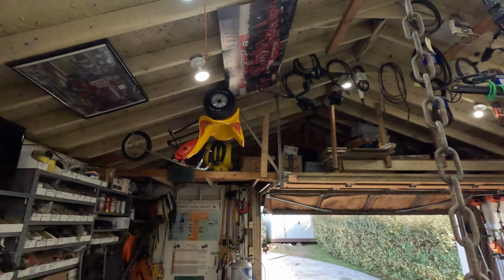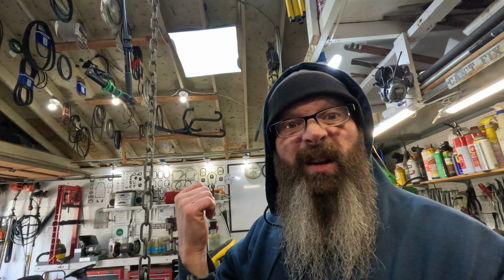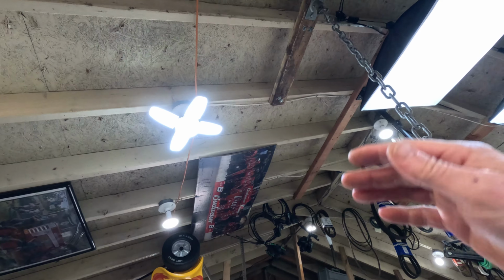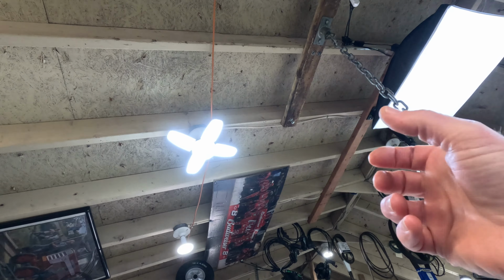So what I'm going to do, I just haven't done it yet. I've been meaning to for years now. I'm going to go to Lowe's or Home Depot, and I'm going to get something lightweight, like a 10-foot, 2 3/8 galvanized chain link fence post, like a top rail, something strong. And I want to be able to put a little bracket on the side of that rafter. And whenever I do this, I can just reach over in a corner somewhere and grab that pole and stick it up in the bracket. That way, when you pick a tractor up, the weight is on that pole and it's not pulling the roof, because I do worry about that. Makes me nervous doing that. That's my livelihood. I don't want to pull my roof down.